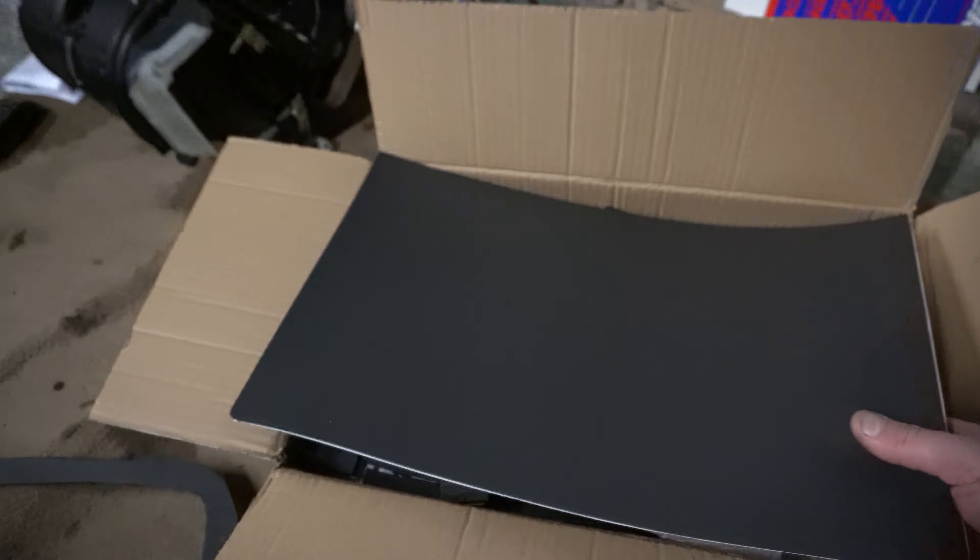While I've had the heater box out I've done a bit of work on it - the aircon matrix removed, the heater matrix removed, the pollen filter removed, and one of the flaps has had a repair. There are two flaps that control the exterior or interior flow of air into the car. I've re-trimmed these foam pads, and had a breakage on the pivot pin that I've had to fix with a bit of JB Weld. The pivot pin will eventually end up in this arm here, and I'm fairly confident that fix is going to work.